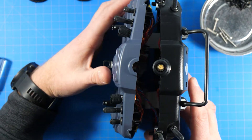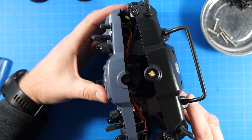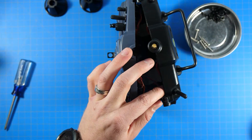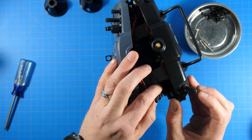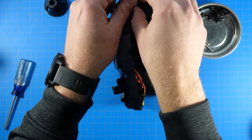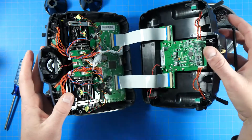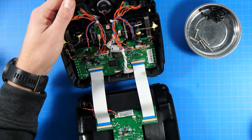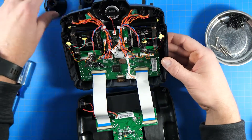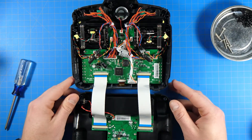Don't pull it too far because you'll end up pulling the switches out. Instead, we're just going to remove these two switches — they should just slide out. There's one, let them hang there, there's two. That takes care of the top, but we still have the ribbon cable on the bottom. That's fine — you shouldn't have to disconnect that cable, just let it be and be gentle.